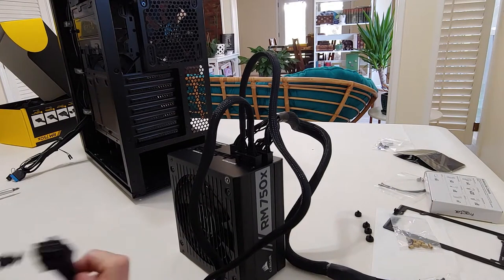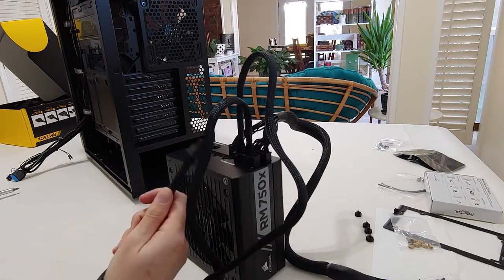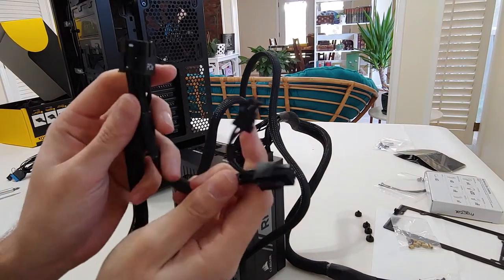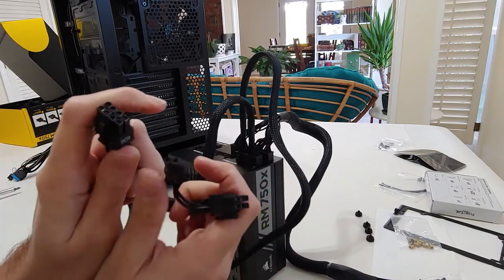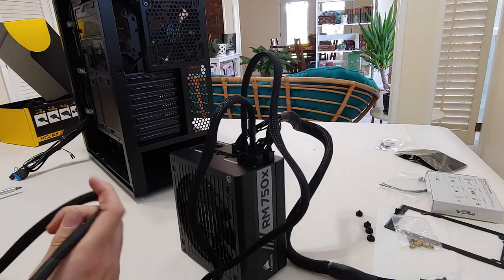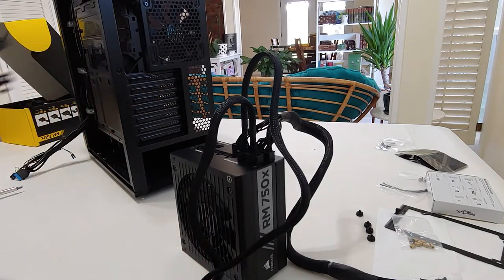You know, the neat thing about making this build with the guys, I actually noticed something. So that's going to be the 8-pin connector is going to go straight into the power supply unit. And then I noticed on the other side, there's two of them together right there. I didn't realize there's one cable for two connections. So we will need two 8-pin connectors for the card. So this actually shaves one cable off from the power supply unit. So not a bad deal. So we're going to plug this in and get these guys over there into the video card later on.